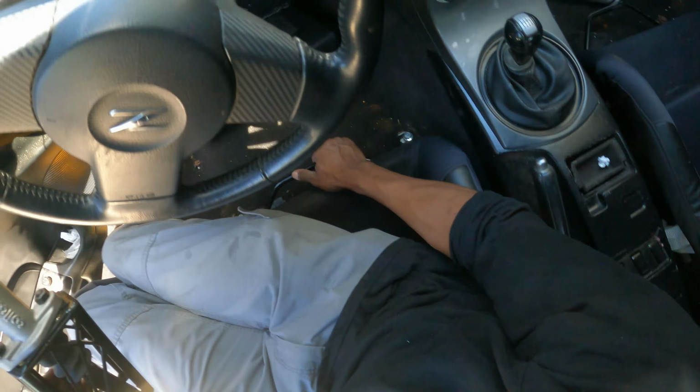So if you're concerned about scratching your fittings, wanna keep them nice and black or whatever color you buy, you can buy an AN wrench. Aluminum, anything like aluminum is going to help it not scratch the surface. Still get scratches though, but not really scratch the surface as much. So do this, spin this up here. Another thing you can do is put a little duct tape on this end or whatever end, and you could use a regular pliers. So we're gonna go ahead and do that since I have a bunch of duct tape here.